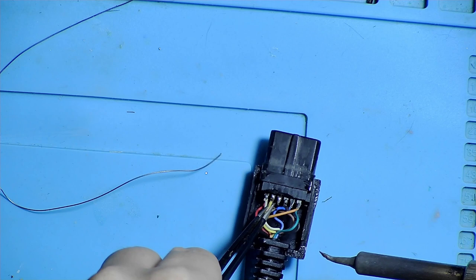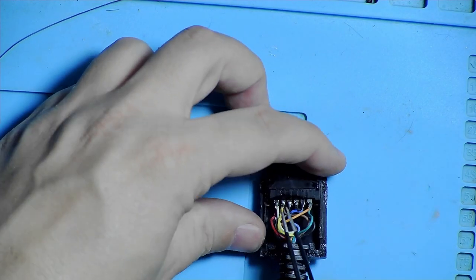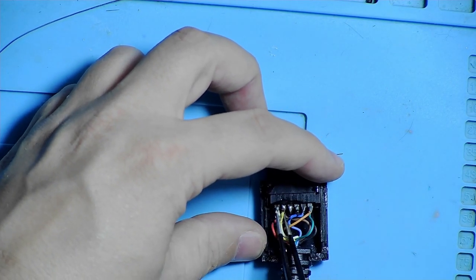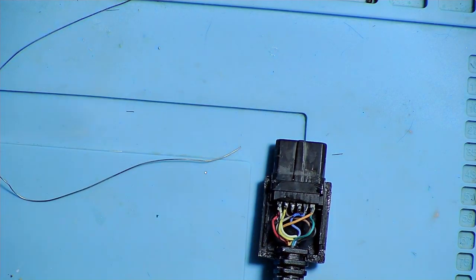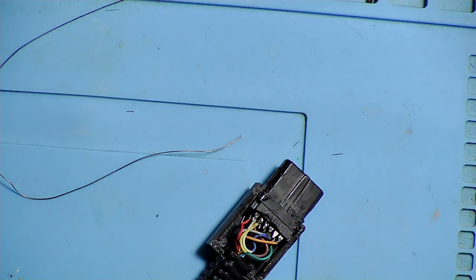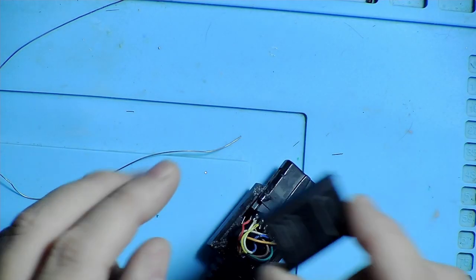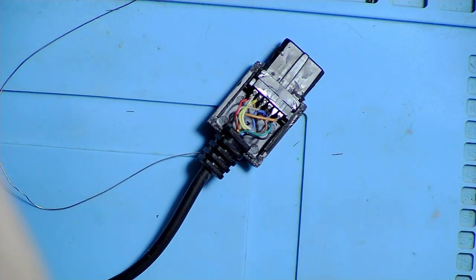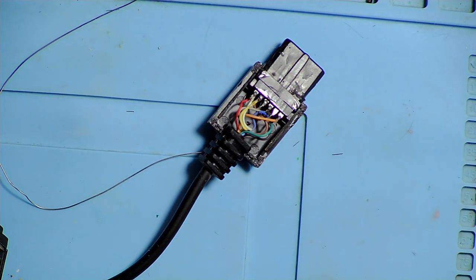It's done — it's that easy. The cable usually comes the sync-on-luma way from AliExpress, but if you buy a specifically sync-on-luma cable you need to do this mod to make it work on the GameCube, because the GameCube is missing the luma output from the multi-out, so you don't get any sync signal and it won't sync to the upscaler.